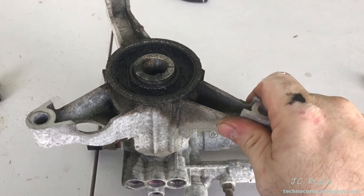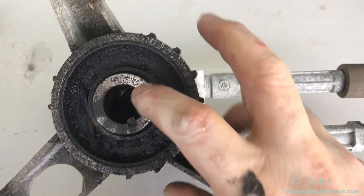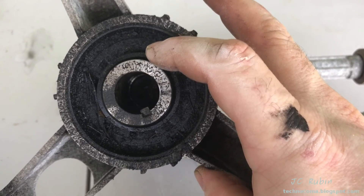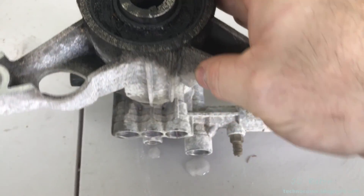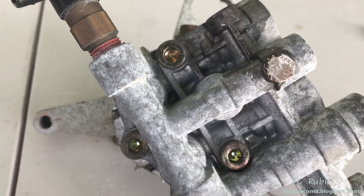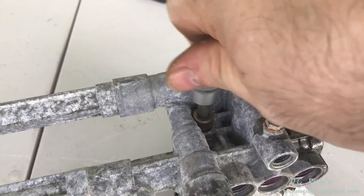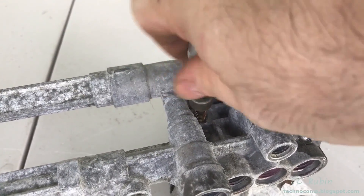This is the pump. The three screws that held it in, seal up top. We can see a key on the shaft so it holds it in place — the engine spins and the pump spins with it. There is engineering in here to maintain specific pressure. There are three hex screws on the bottom that hold the pump together. I'm removing these now. This is six mil — it put up a little fight, but a lot less of a fight than I had expected.